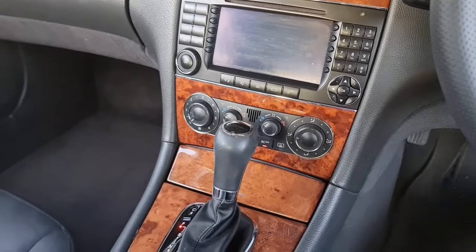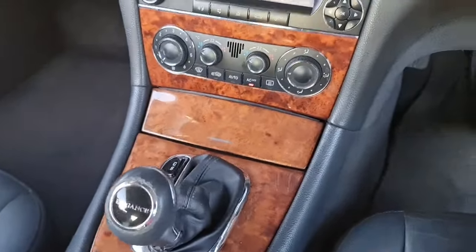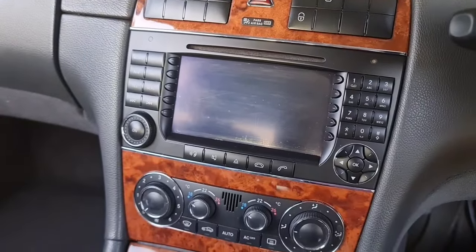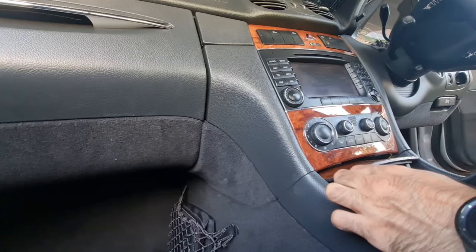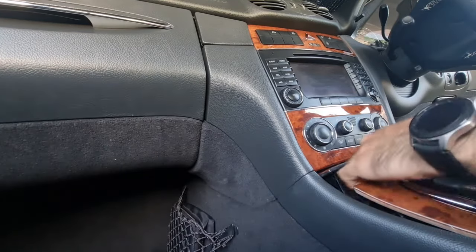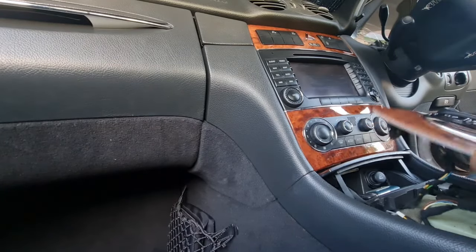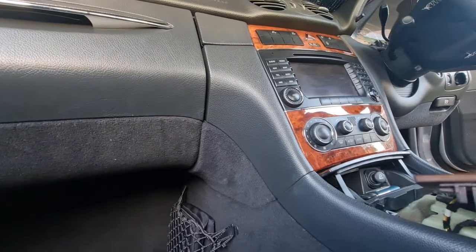The first thing I need to do is put the gear in neutral position so I have more room to work here, then turn off the ignition. I don't need to remove the gear shifter bezel — just lift the gear shifter board up, release the cigarette lighter compartment, slide it out, and rotate the ashtray off.